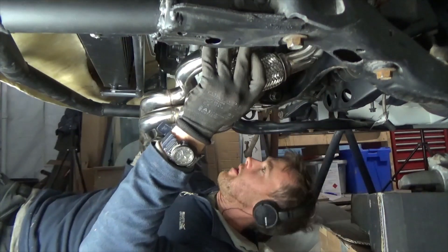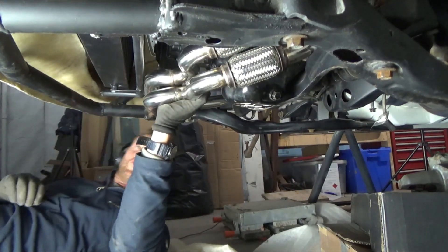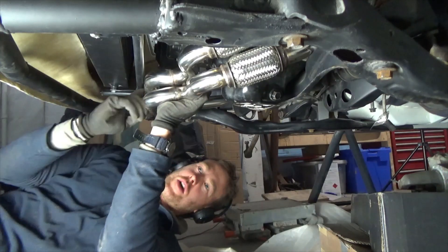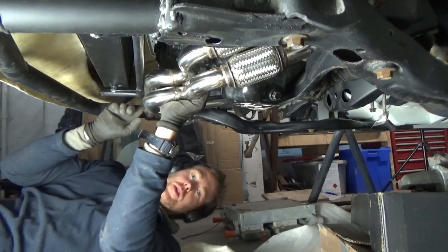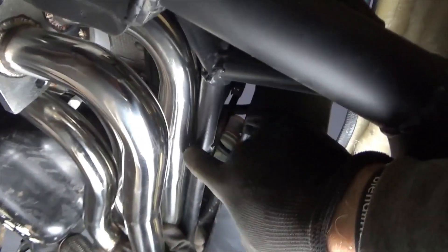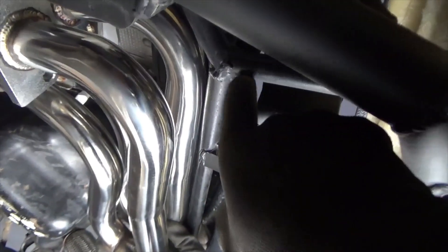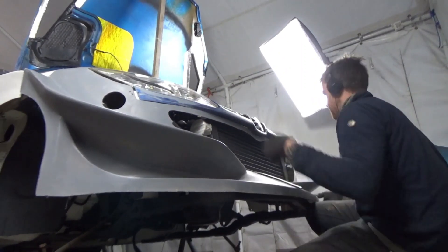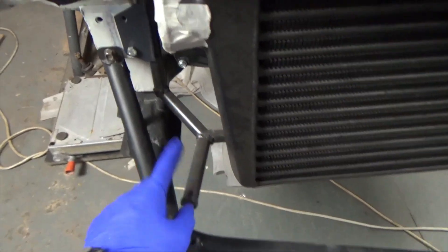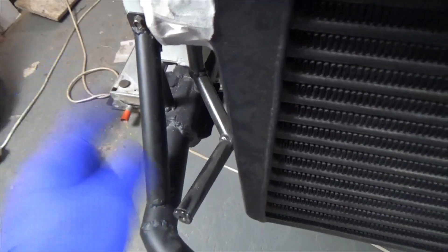Let's see if it fits. As I first predicted we are just about touching the clip at the bottom of the intercooler — only by a couple of millimeters, so with some small adjustments to the bottom end of the clip it should fit on well. It's in place now but it's sat snug against the clip. So all I need to do is take the front bumper off, take the intercooler off, then cut this bar and mount it slightly further out to account for vibration and movement on the engine. It's very important to keep the mounting points for the front bumper, so I'll just cut the bar that runs across the back of the intercooler, bring it out, and weld it in situ.